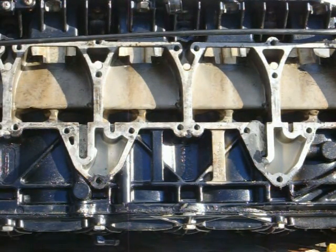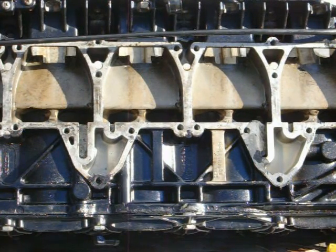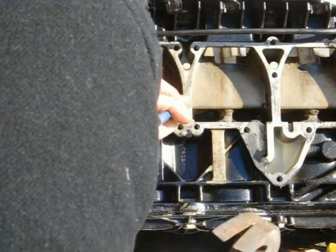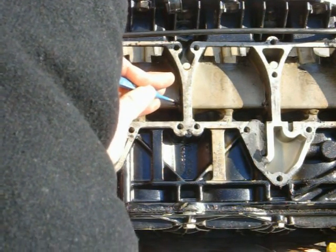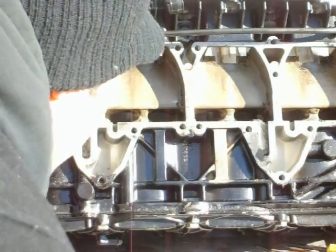Once you have the face nice and flush there, ideally you would get a punch that's used for starting holes, that you would tap a hole with to drill, but I can use this on the side and just gently get in there a little bit further so that the face is flush. Once that face is flush, take a little side angle and swedge the corner in, and that'll hold it in there. Do the same on this one because I already did this one. So those don't come out. You don't want them coming out.